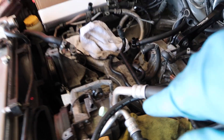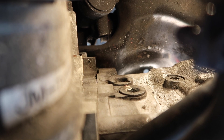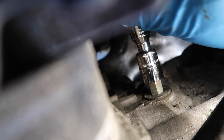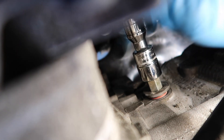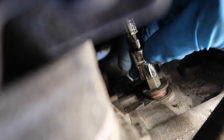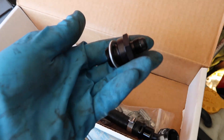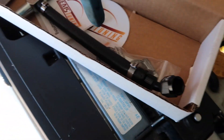Coming from the top side, you're going down here. If you see that plug right there, that's what we're going after — that's what we're going to be removing with a 12-millimeter hex socket. Once you have the plug out, then you're going to want to grab this guy. This is what's going to go in the back of the head and connect up to the rest of the cooling head mod.